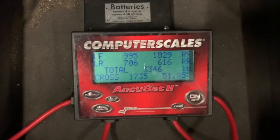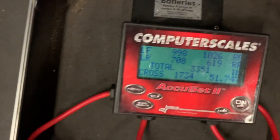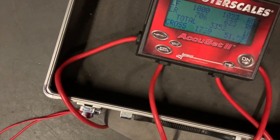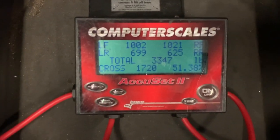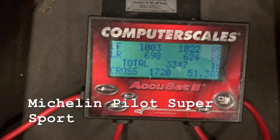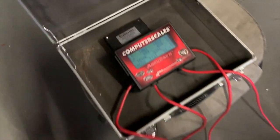Yeah. But who would know? The tire is hot. All right, so we're going to lower it and see what happens when the tire is hot with pressure. Up, up. 4 or 5 times. Yeah. In the morning, it'll be down maybe 28. Yeah, you're right. So that's 30 PSI all the way around. I mean, usually that's where you want to be to race this tire on the track, maybe 28, 30 around that area. But as long as they're all even now, we're going to be fine with our corner balancing.